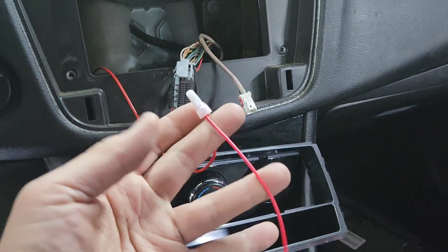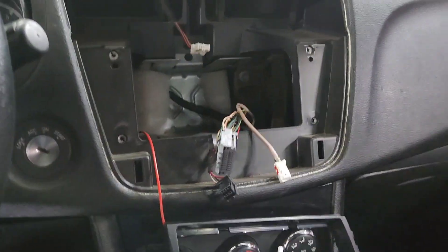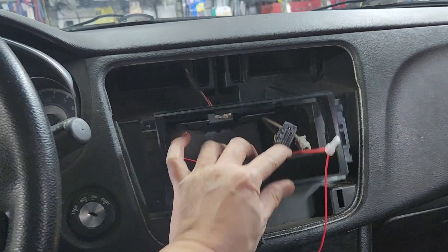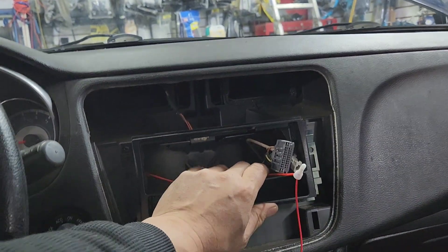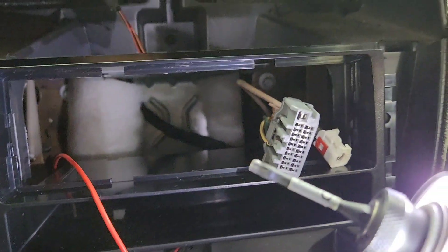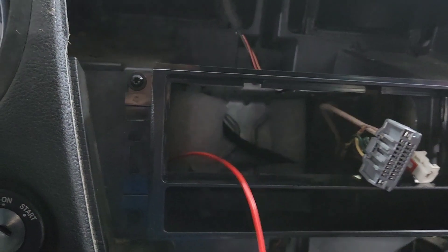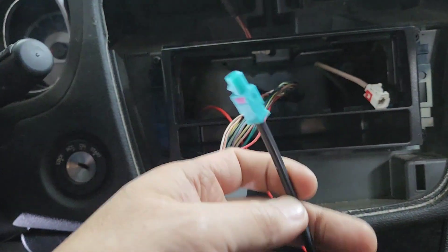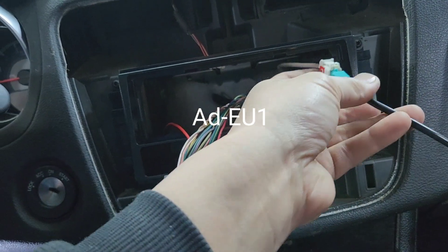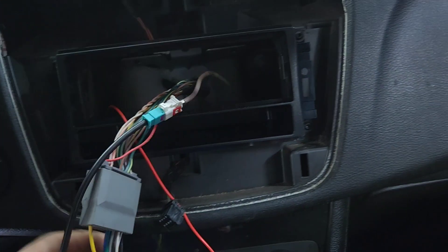In my case, as you can see, there's no red wire, so the accessory wire needs to be run right here to the fuse — I'll show you which fuse it is. I'm going to put the mounting kit back in here; the mounting kit is 99-6511, and I use a Torx T25 to put it back. I'll plug everything back now. If you want to listen to the radio, you'll need the antenna adapter called ADEU1 — just plug it back in here and snap it in.